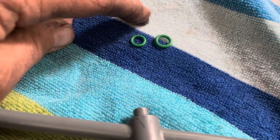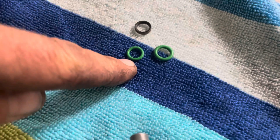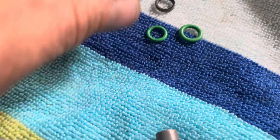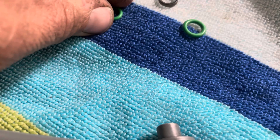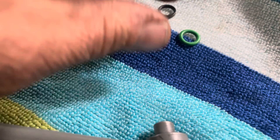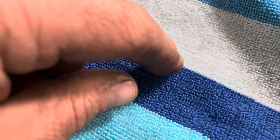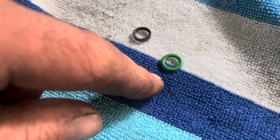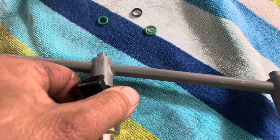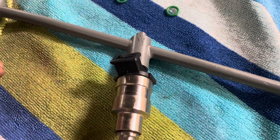Here is our OE O-ring. I found these locally — they are quarter by three-eighths by one-sixteenth. They fit okay, just a little bit not snug enough — sketchy. But this guy is a quarter by twenty-seven sixty-fourths by five sixty-fourths. I've tried it on this new injector here, and that baby is tight. I love it. That's the winner — that's the one we're going to use.